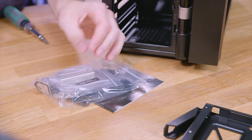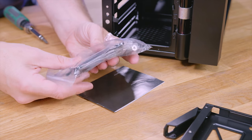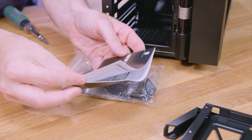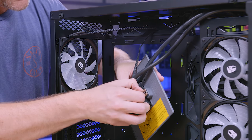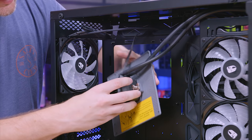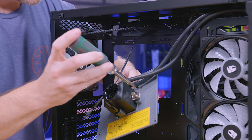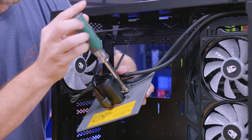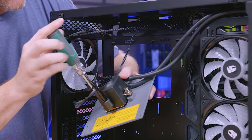In this black box, we've got a few things: our mounting mechanism for our cooler, our thermal paste, and of course our instruction manual. Now, this big gray piece right here doesn't actually stay with the pump — it's mounted down to the motherboard tray and the pump is mounted to it just to keep it safe during transport. This part gets removed, and you replace the pieces using the manual with the mounting bracket for your socket type.